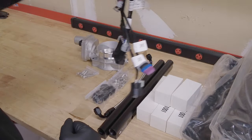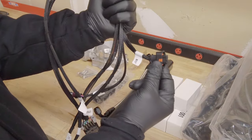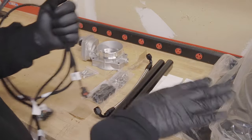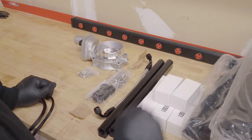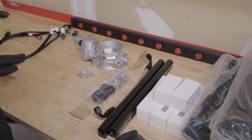There's a little wiring harness for the style of map sensor we're going to be using. This is just a one bar. If you need to use a three bar, you might have to drill a little bigger hole in the back of the throttle body — not a massive deal, really just depending on what you're doing and how you're doing it.